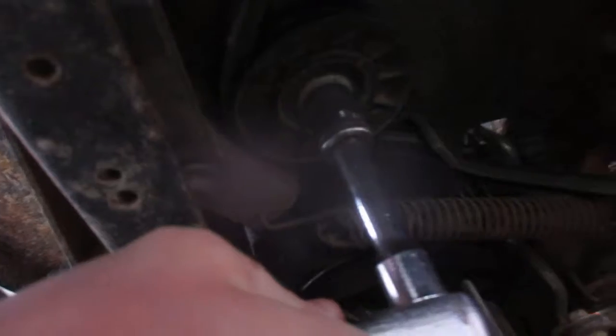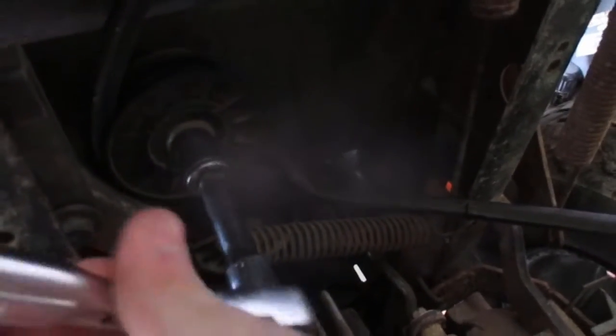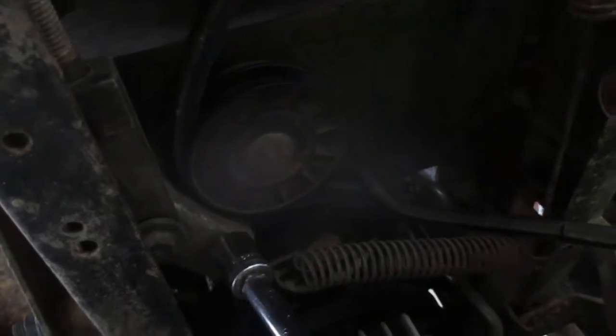Let's go underneath. I'll pull this belt back away from that pulley. Next, these pulleys here are probably going to have to be unbolted to get the belt off. Now that it's moved from that pulley, we'll take off the parking brake so we can unhook that tensioner spring. This is going to need a 9/16 socket. I took the clutch off — I might actually want to put it back on. Take the 9/16 socket and take out that bolt — it's going to hold this tensioner assembly too, so I want to take that out last. Let's start with this bolt here, and unhook the tensioner spring.